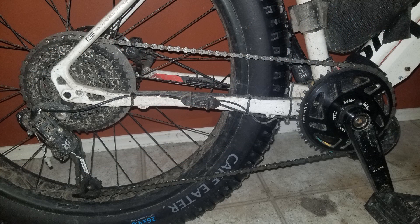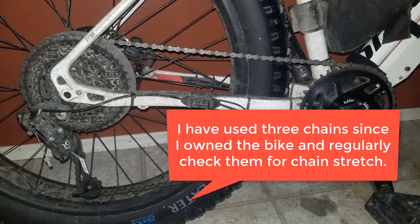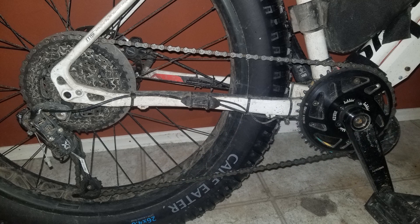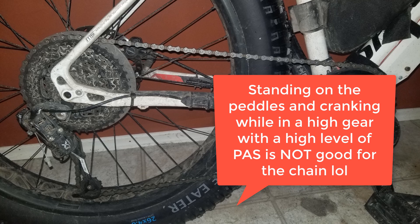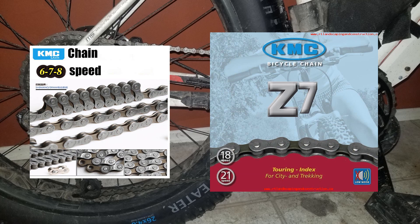I don't go through chains on a weekly or even monthly basis. I'm sure that I will wear them out faster due to the higher power levels but it's not something I think about when I'm out riding. I broke the chain a few times when I first got my BBS HD, and it was always when I was trying to get the bike to go fast in the wrong gear. I quickly realized this and changed my riding style to prevent it happening. Some chains are simply not strong enough for e-bike use — I now use KMC chains because they last for me. When I first jumped up to 50 amps I had a chain come apart in four places all over the path, but it was a chain that had over 5000km already on it. So right now I use a KMC 6-8 speed chain which is much thicker. It's been no issues for about 2000km now. It does effectively make it a single speed bike, but seeing as how fast it goes, that's not really a problem. I check the chain regularly with the tool to ensure that it's not stretched and that it's holding up well.